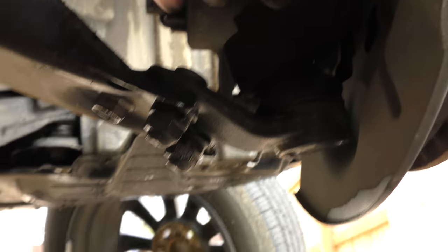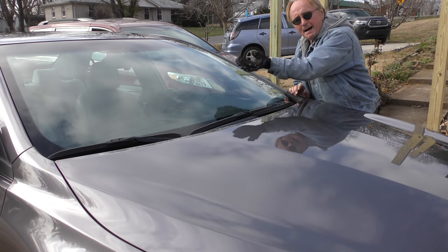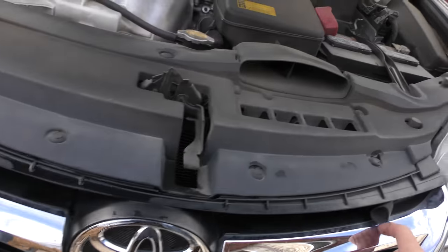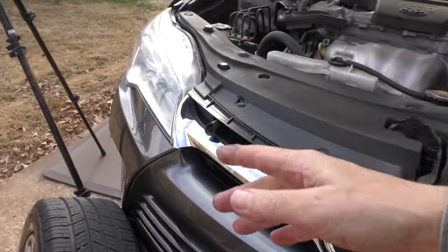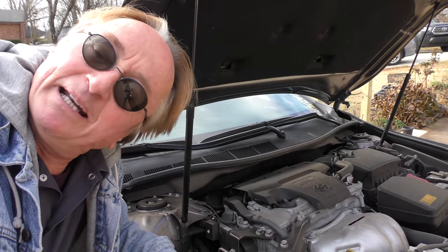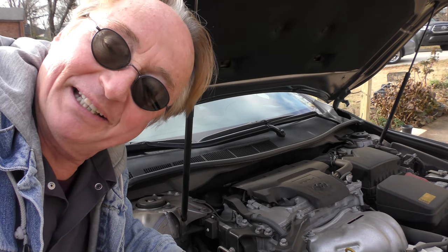Now when we check the bottom side here, here's a lower ball joint, and as you can see it's perfectly dry — it's not ripped or torn, there's nothing wrong with that. And the tie rod's nice and stiff, it's not clunking or bouncing around. Let's pop the hood and check the top of the strut. We're here in Tennessee — those devices are supposed to make noise so that the deer don't crash into it. That's not the source of this noise, because humans can't hear that frequency. He's never hit a deer, so why tempt fate — I'd leave them on too.